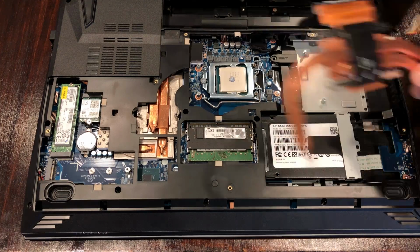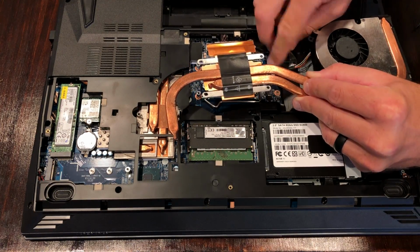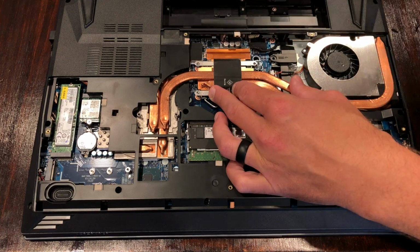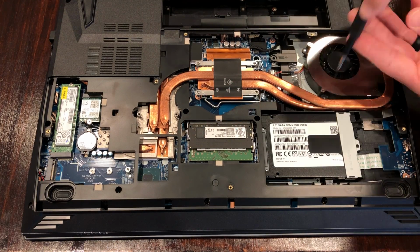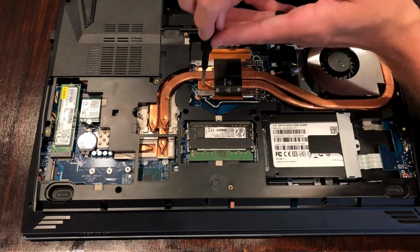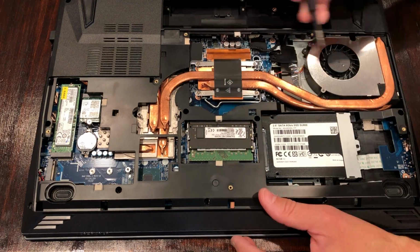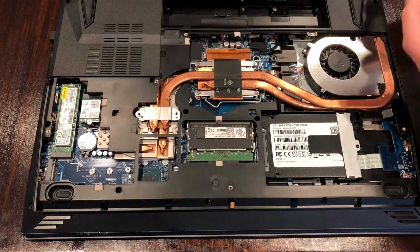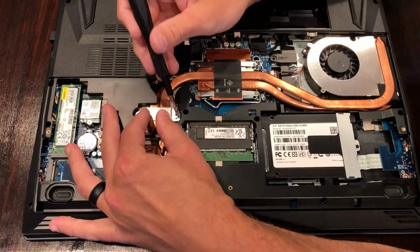Before carefully installing our CPU cooling solution, I'm going to carefully plug in the fan. I did find this to be a little bit easier for me. This is slightly cramped. Perhaps you will have an easier time should you have smaller fingers. Going to reinstall the 2 black screws to hold the fan onto our chassis, the 4 screws over the CPU plate, as well as the 2 screws that hold the cross member in place for our CPU and GPU.